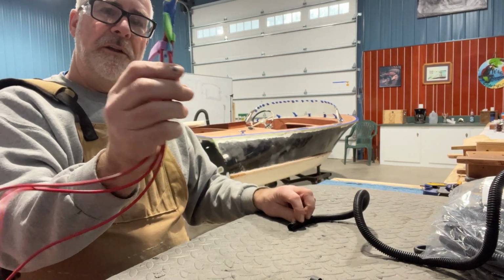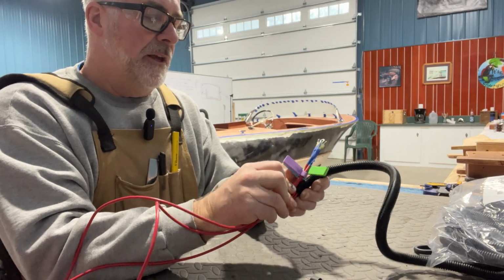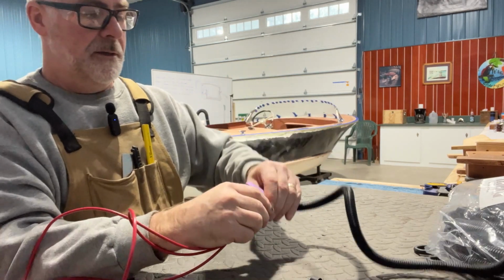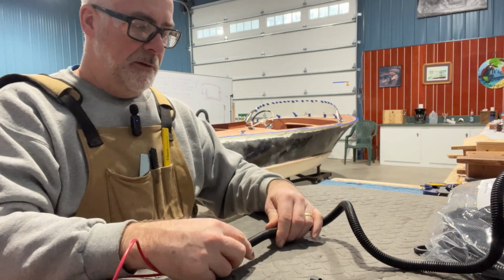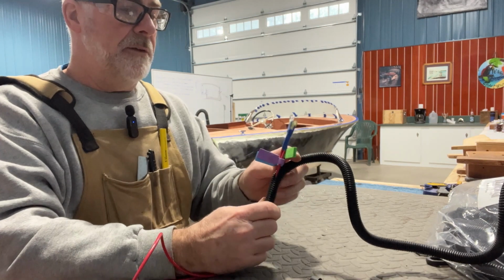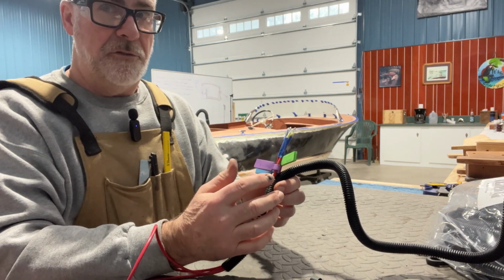So this is what I do. You take your wires and I tape them. The hard thing about this is the starting. So what you do is you just get it going at the end. And then once it's in, you just pull. And what I'll do is I'll pull this wire, the 14 feet that I have laid out. And then when I get to the end, I'm going to leave these out and I'll clip it. And then I'm going to tape this off so that they don't move within the loom, because that's, again, chafing.